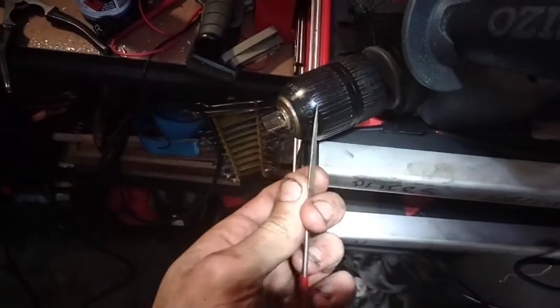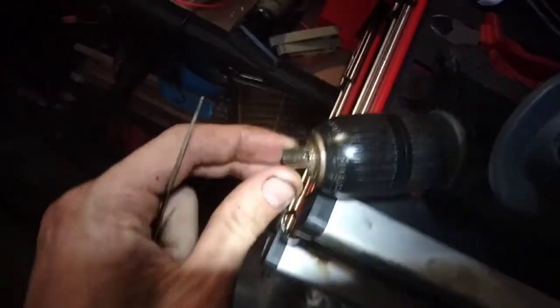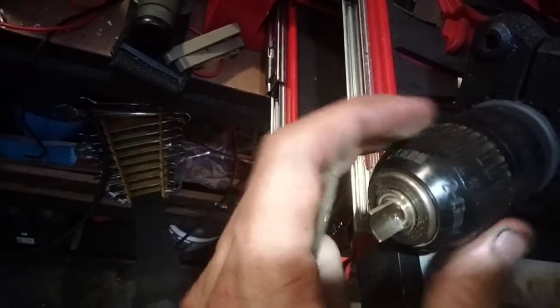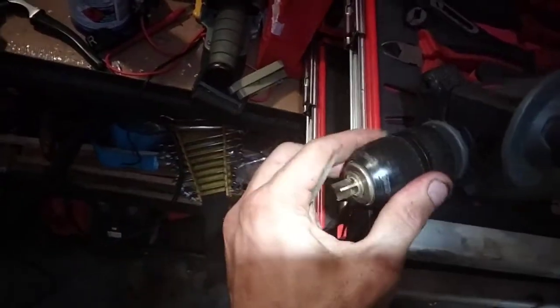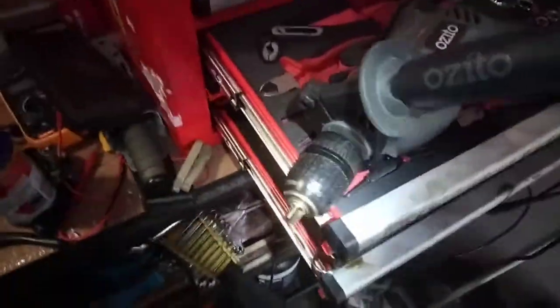I'll just try and show you what I'm doing to try and face up this valve. I have a little very fine hobby file, and what I'm doing is just ever so slightly pressing it inside of that lip there, so I don't damage the little fins — probably to direct the oil around it. It's a little bit dirty at the moment, but it's actually coming up really well. We've nearly faced it out — there's still a little bit more to go over here, it was a little bit on the piss. Hopefully we'll be able to clean it up enough that it will function well. This is what you do if you don't have a metal lathe — but please, put this in a metal lathe people.